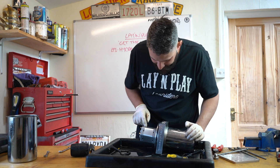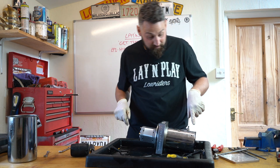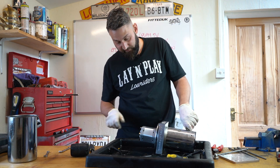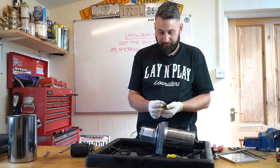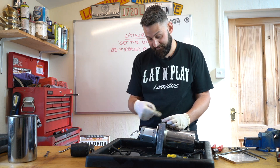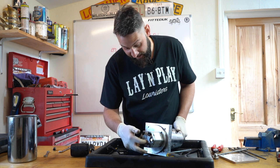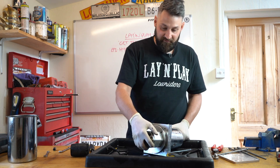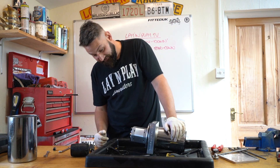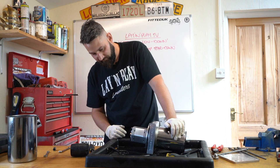This is your pump head. You've got a motor, an electric motor, that's connected to your solenoids - we'll do another video on that. When this motor spins there's a spline drive, the motor spins that and it spins the pump head. That draws the fluid through there and then smashes it through the pressure port, which is what sends it to the rams. This has just got a set of gears inside. We can save stripping that for another video.